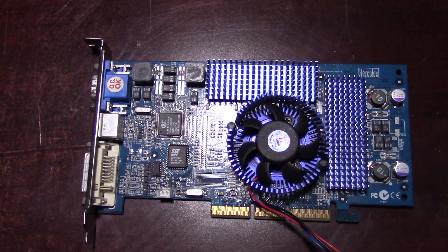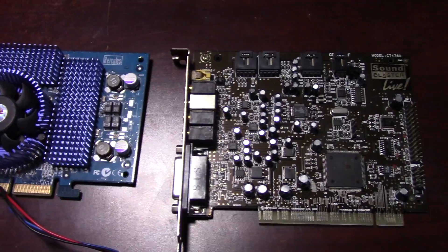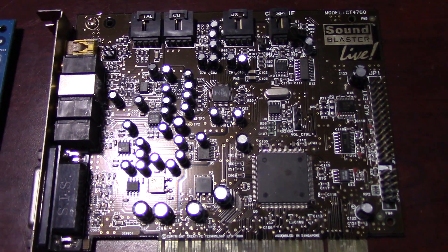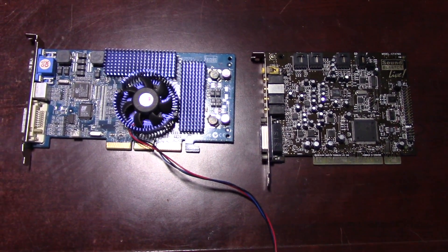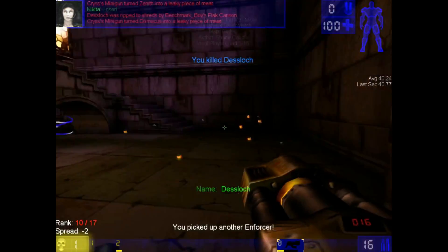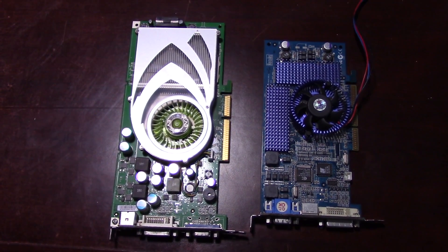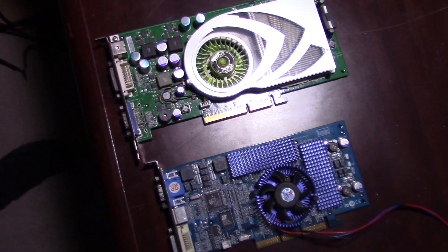The video card is once again the Prophet 3 GeForce 3 with 64MB of RAM, and a Sound Blaster Live X-Gamer. Benchmarks are run with sound enabled, just like in the last video, as I feel this is a more accurate representation — you play games with sound on, so benchmarks with sound disabled aren't a true representation of actual performance. I also ran benchmarks with Windows XP Professional to show the performance difference between Windows 2000 and XP. Since this board has AGP 4x, I also ran benchmarks with my best AGP card, the GeForce 7800GS, to see whether the GeForce 3 is holding back the processors.